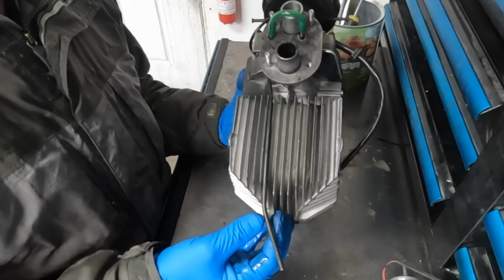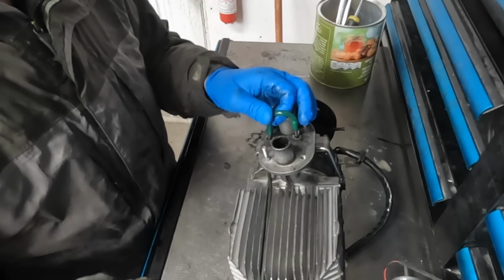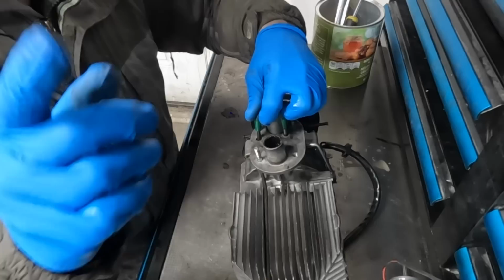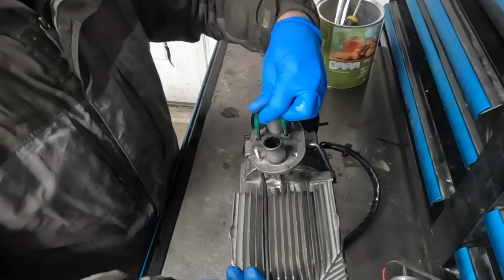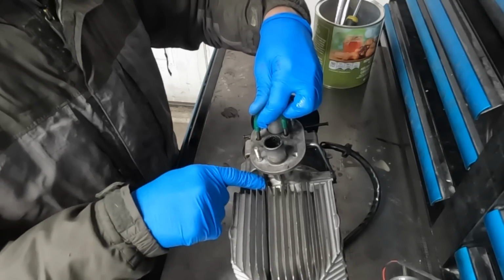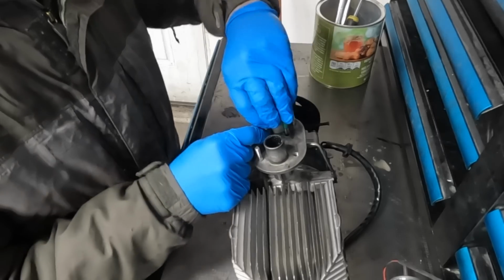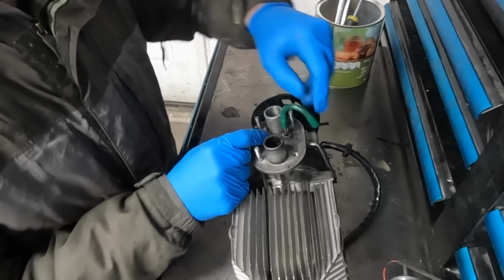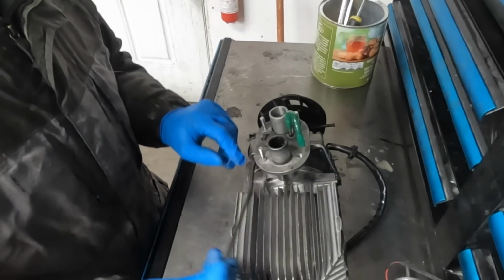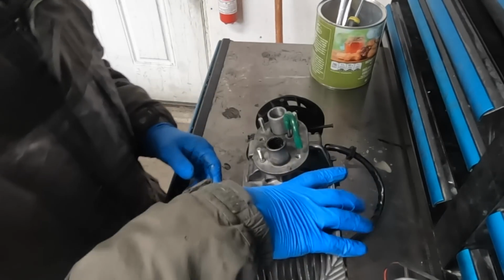for preheating the fuel. This is a modification that I made to mine because I'm running a waste oil mix in it, or experimenting with a waste oil mix. I recommend you do not do the same. The oil and diesel come in through here. They get preheated up to about 100 Celsius, and then they go through this loop and into the heater. So we're going to remove this to get it out of the way. Comes off fairly easily, just like that. And that is a piece that yours will not have.